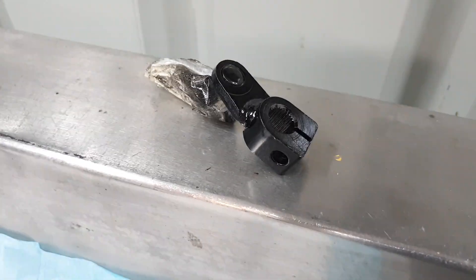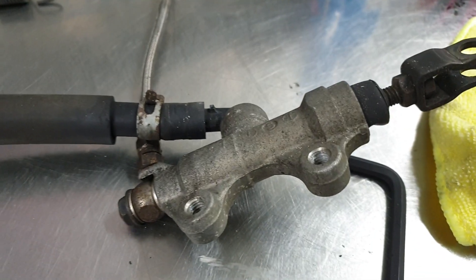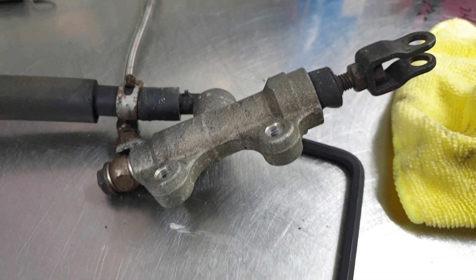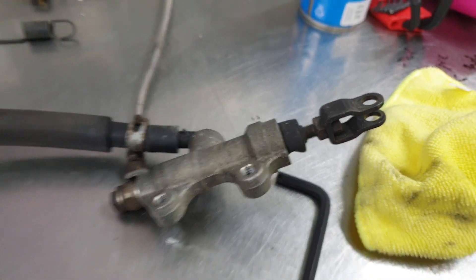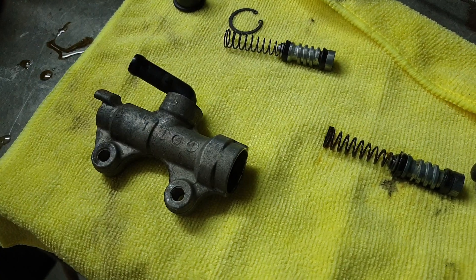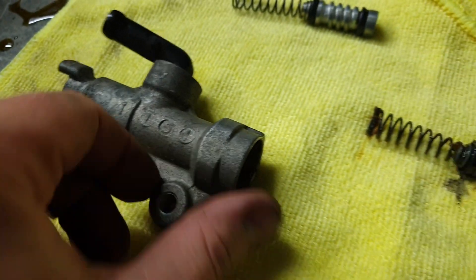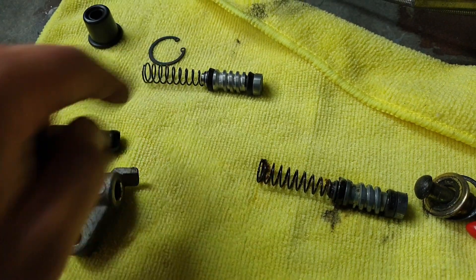All the parts are painted now, bits of black lacquer hanging everywhere. While I'm waiting for that to dry, I'll put the master cylinder kit into the rear brake master cylinder. I'll strip it down, soda blast the actual housing, and reassemble it with new parts. I've stripped the master cylinder down, going to soda blast it, wash it all out, and then reassemble it with the new kit — which is this guy here.